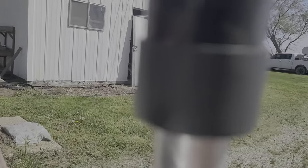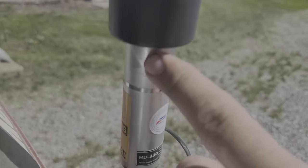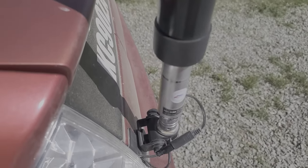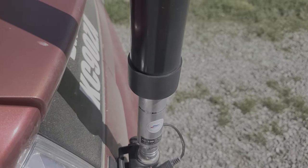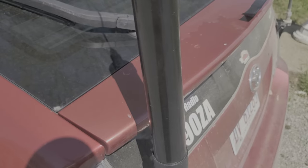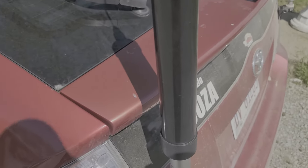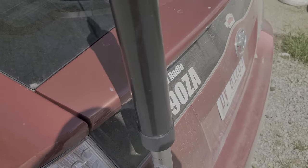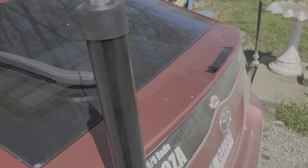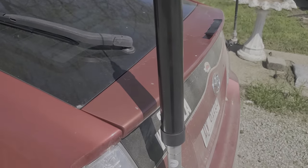They do have a little measuring system to show you that the antenna is moving up and down, but unfortunately where it's placed on the car I can't see it. Usually I just key up on CW at 5 watts — the FT891 lets you set your AM or CW power separately from your sideband power — so I swap over to CW, key down, and run the antenna up or down for whichever band I want. I usually have it tuned within 15 seconds. It runs fully up or down within about 30 to 40 seconds, so it doesn't take forever.